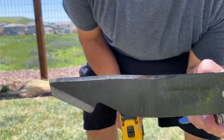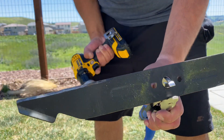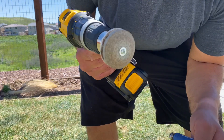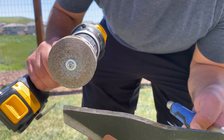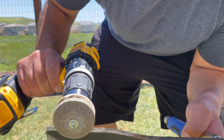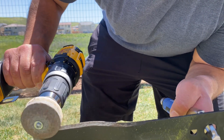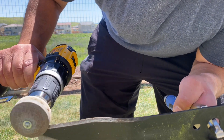Here's the blade — I've just got it held on these little hand grips. It's probably not the safest way, but I've done it before; you'd be better off with the bench vise if you have one. It's not rocket science — you basically just take the grinder and start slow on this edge. You don't want to go too fast because it'll be bucking around like crazy. Just start it and let the stone do the work, grinding it down.